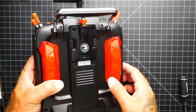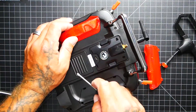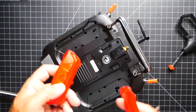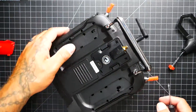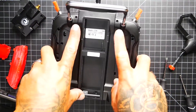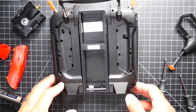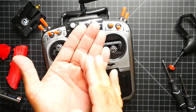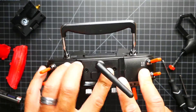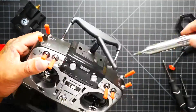I'm going to power this down and pull it apart. There's not much to it — I think there's six screws. These are just 3D printed handle grips I got online and printed on my printer. They fit nice. I took two screws out of there and two more, and loosened these last two. Once I turn the radio upside down they'll pop out. There are also two 2.5 mm nuts on top — once we loosen those, the back just goes plop, so be prepared.